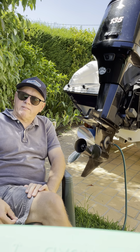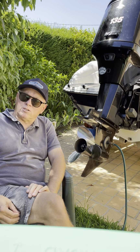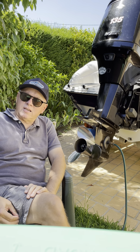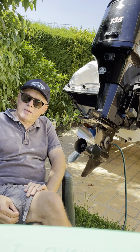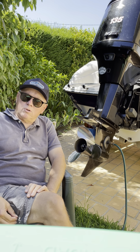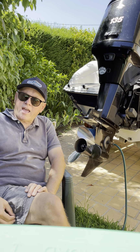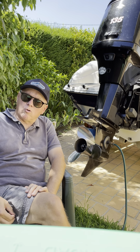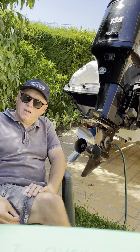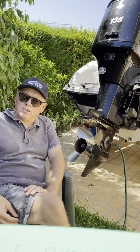And there's actually another set of injectors on the fuel rail which injects a very fine mist of fuel, just fuel, no oil, into the cylinder, a very fine narrow mist at slightly less, about 80 psi, and it's got very precise control using the computer on the engine, and so it's able to achieve almost a complete burn compared to the very inefficient burn of the old traditional two-strokes. So that's how it sort of achieves its efficiency.